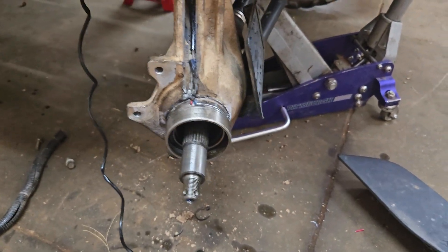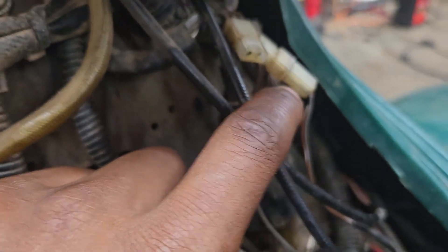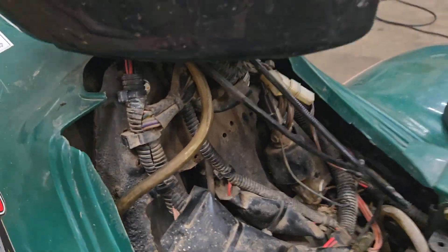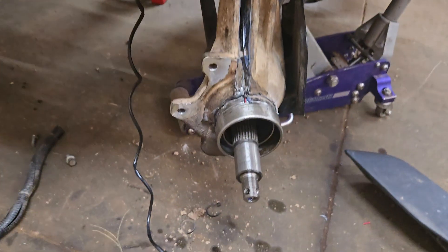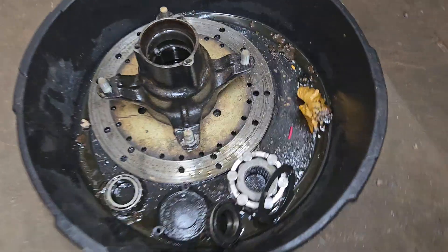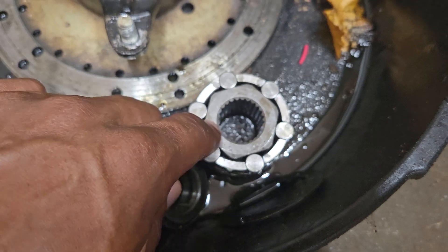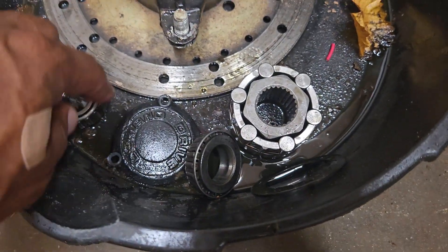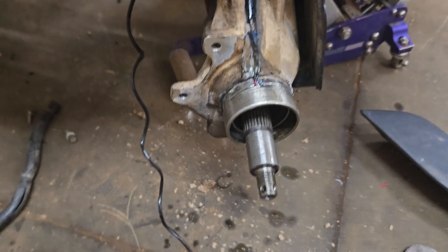That's the essence of the four-wheel drive. If you don't know if the four-wheel drive is working, come up here to these wires and check if you get 12 volts there when you turn the key switch on and engage your four-wheel drive. You may have to run the engine to actually get four-wheel drive action, but try turning the key on and flipping it — you should get 12 volts there. This is a magnet and it just grabs. I made the mistake one time of replacing all these parts — if you don't see any visible wear and there are no metal shavings, these things are fine. They don't really go bad, so don't waste your money buying one of these or replacing the whole hub. This magnet is nine times out of ten the culprit, and like I said, it can even display magnetism, but the magnetism can be relatively weak and it's not enough to lock the cam.